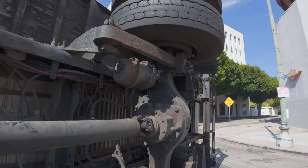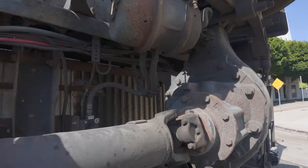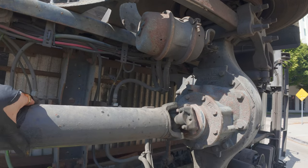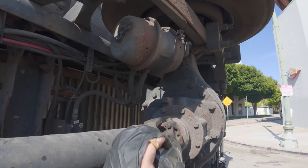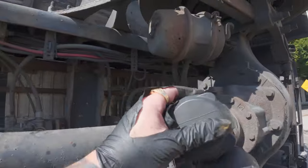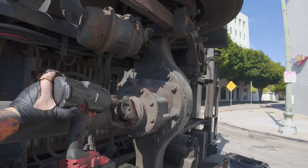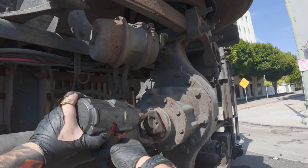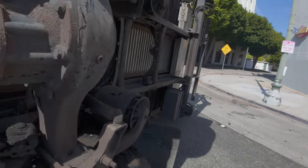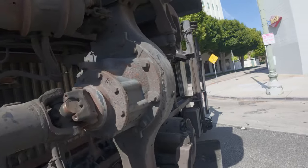While Alex is about to hook up the front, let's take off the drive shaft — you already know why. You always got to make sure there's play. This will kill you if there's only tension and no play. A lot of horror stories about that. What's cool about this Milwaukee one is it breaks it first instead of continuously going, to prevent stripping — so I just hold it. Nice, right? It's the little things in life. Now, this is easy to do on these because they're just three-eighths. You can probably get a strong man to do it by hand.